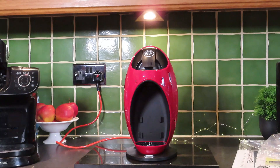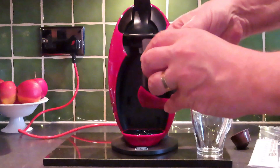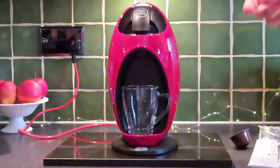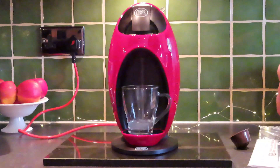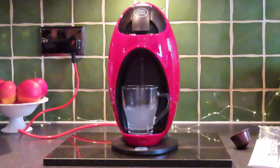When you first use the machine with your tank in, you should find a little cleaning funnel in your kit. That funnel needs to come out when making coffee properly, but initially you need to give the machine a wash through. Hit the button on top, wait for it to go green, lock down on the cassette with the little funnel — there we go. This washes out anything left over from the manufacturing process. About once a week you should run this cleaning cycle to prevent any build-up of coffee, tea, or particularly if you've been making hot chocolates or other drinks.